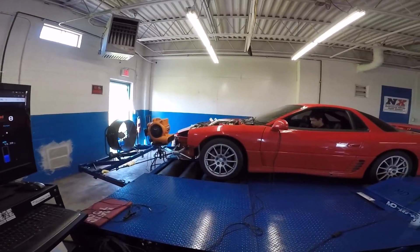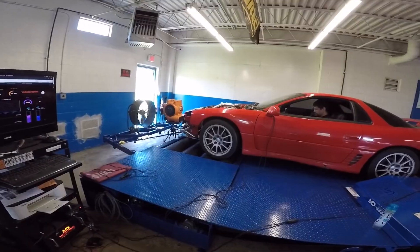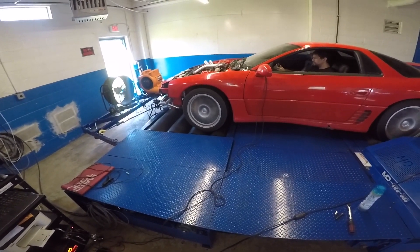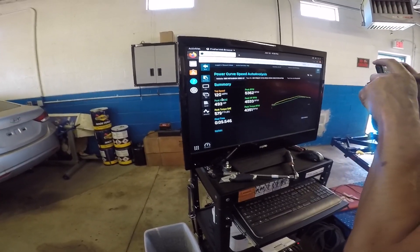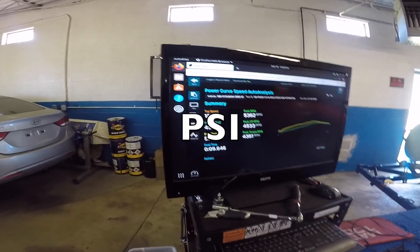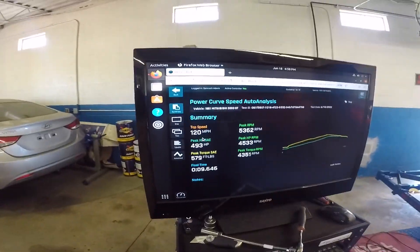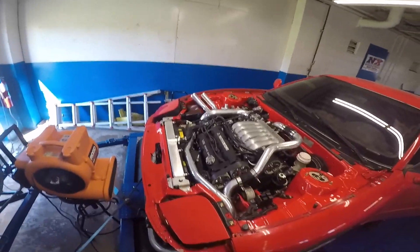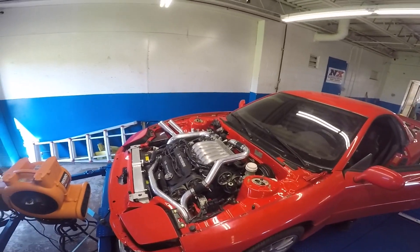We turned the boost up. I don't think it matters too much at this point for horsepower - I think we're running out of turbo - but at least we'll see some more torque. Boys, we're calling it. We never even hit 500. We're running out of injector, we're definitely running out of turbo. We're at 29 psi and even at 34 we hit it a couple times - not making any more power. Turbos are maxed out. But we're at 580 foot-pounds of torque. Coolant temp only hit 189 on that last pull, running all day - we never even saw 200 degrees on the radiator today.